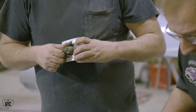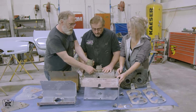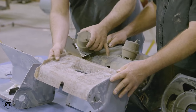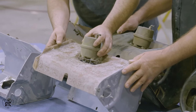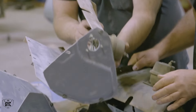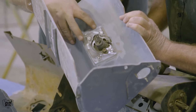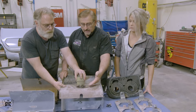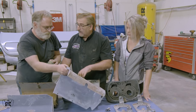So you put the actuator on. Now what we have is this — simulated like this. And since the original screws into sheet metal it'll hold together, but we made a bonding strip because ours is fiberglass and you can't screw into fiberglass. We made this plate here which I bonded in, so we have a stud plate for strength to hold it in place. Now you just put your nuts on there and you've got exactly the same amount of strength, if not more, than the original had.